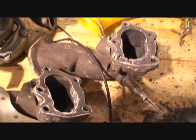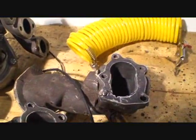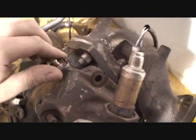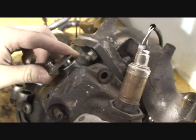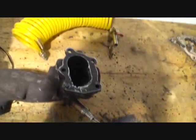As you can see, after cutting with the plasma cutter, we cut that port out for the wastegate flapper to open up, and you can see it's got a clear path. Now when the O2 housing is installed, we go to open the flapper — much more traveling. Before it would open up to about there, and now we got all that. Same thing for that one.